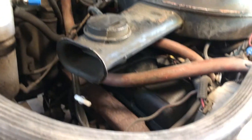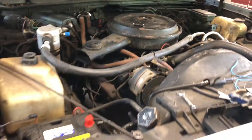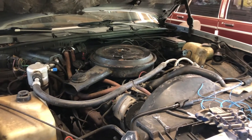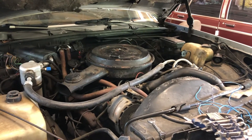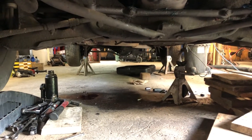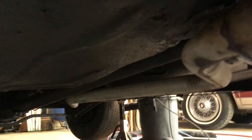I'll get the starter motor in there today. I lost about three quarters of a pint of transmission fluid — the transmission got tilted a little bit during the whole process. I lubricated the dowel pins nice and it slid right in once I got everything corrected. Driveshaft is in, speedometer cable I never disconnected. There was the cross member — it was welded in there, believe it or not, and I had to bust loose the welds. I had to do some grinding action along there.